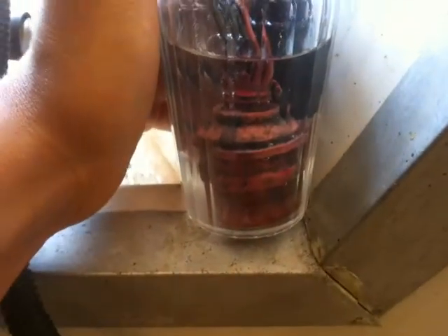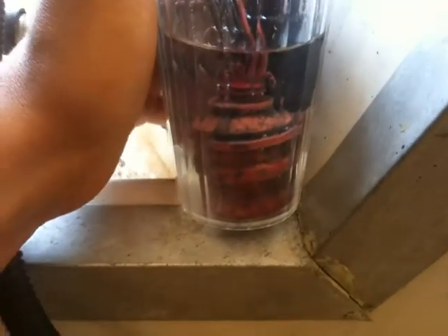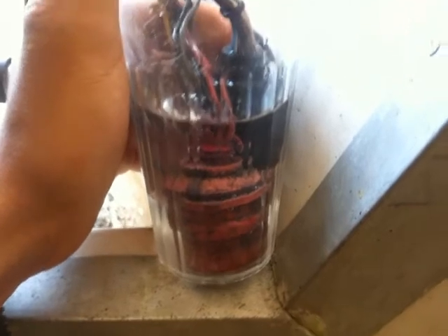After you're done with that, wash them out with some rubbing alcohol or something and blow them out, then put some dielectric grease on it — that'll keep the corrosion down and this will clean the corrosion off.